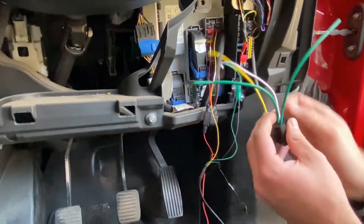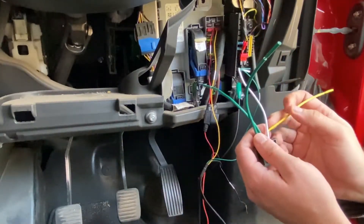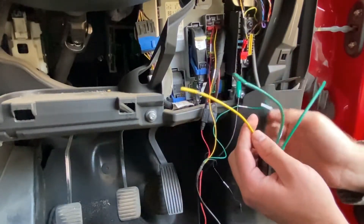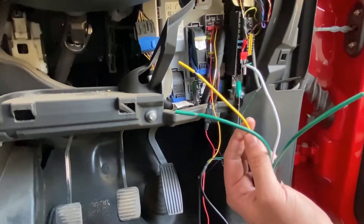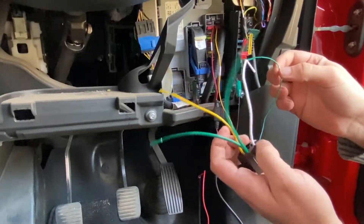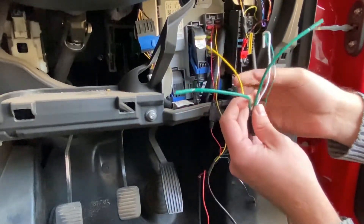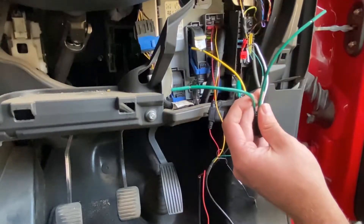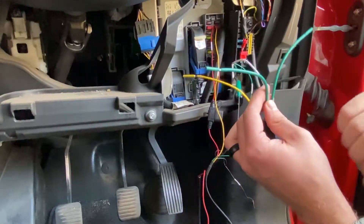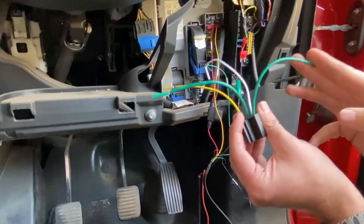Now that we've done the basic wiring of the dashcam, many of you would like to add the relay function to your configuration. The relay needs a positive common on the yellow wire, and then the harness will output a common ground once the command is sent from the app. Basically, you want to give this a 12 volt somewhere in your fuse box or wherever, and then wire the green wire up to the white wire. Then you want to cut your fuel line and wire this relay in between the line that you've just cut.